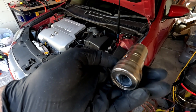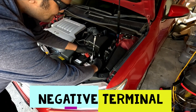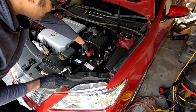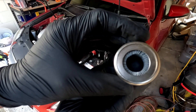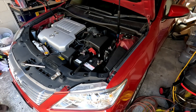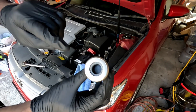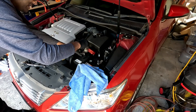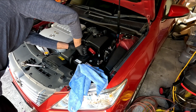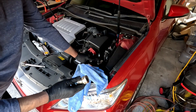This is the battery post cleaner. I'll use a 10-millimeter socket to remove the battery terminal. This is the battery cleaner — you can see there's some corrosion on top. Take an old rag and clean it up. Do not spray WD-40 on the terminals. Use the little brushes on the post, push it in, and you can see how clean that battery post looks.